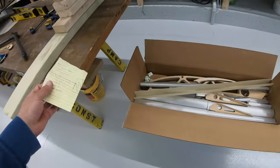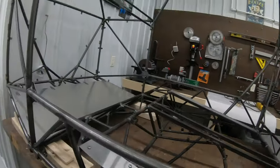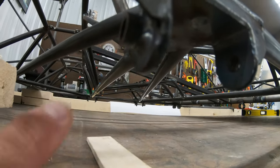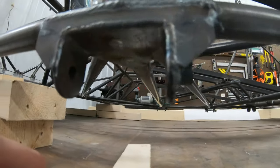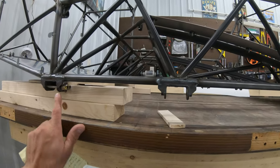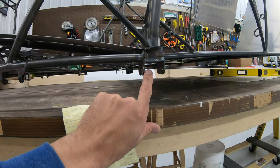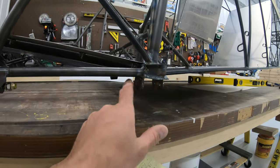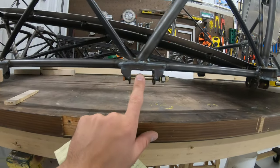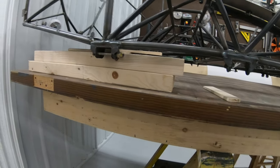One of the other things he recommended was welding little bushings onto the landing gear mount points. There's one on each side of the mount points — a front, middle, rear, and one below the lift strut. The middle one I won't use; the one below is for mounting floats or tricycle landing gear. I'll use the front one for the TK1 Racing landing gear assembly.